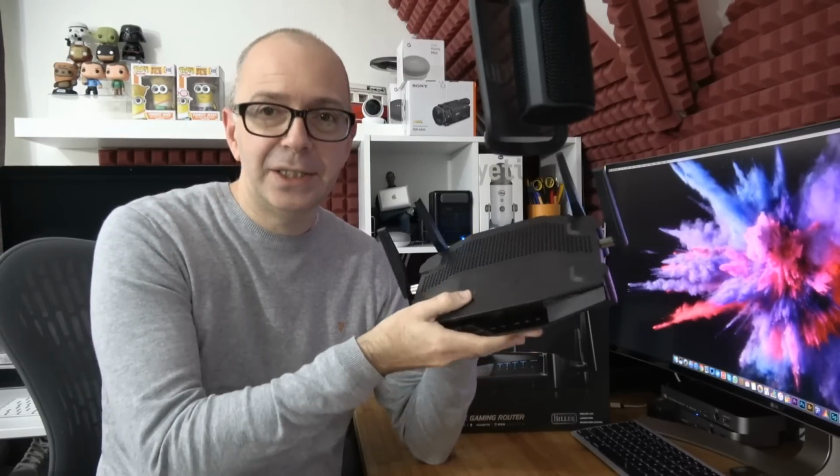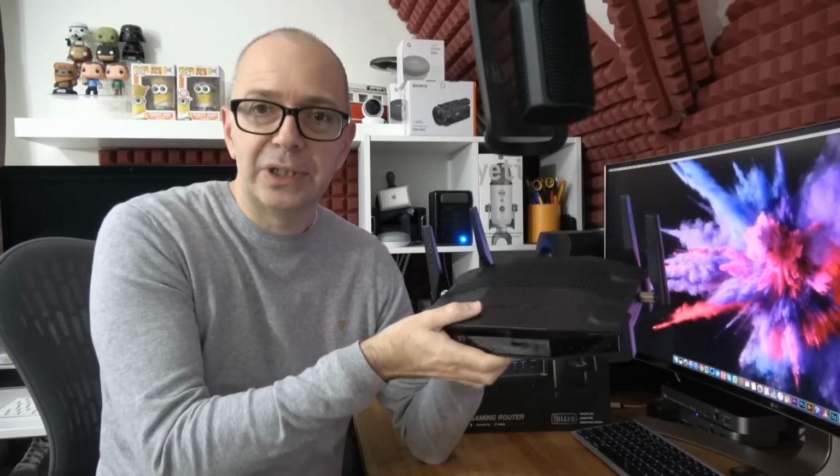And if they really do say they can't support it, then just put your router back to the default mode, disconnect this or whatever one you're using, and get the tech support you need to get your connection back up and running. Then put it back into modem only mode and connect the router that you've been using and you've configured to how you want it.